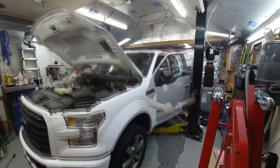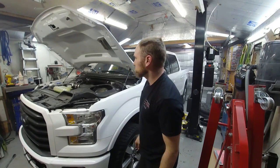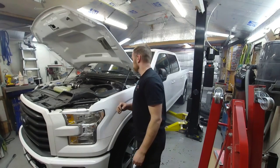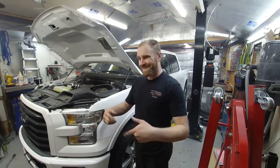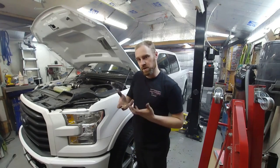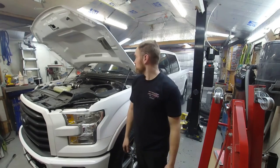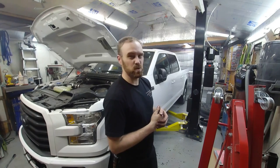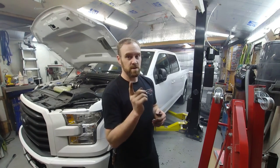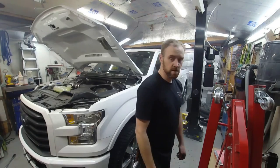That's much better — it runs! I'm calling it quick for the day. A little smoky but not bad — just a small amount of haze, less than I expected. I didn't really do anything in the combustion chambers to cause oil in there, but I did have it upside down for a while and I did pull the pistons up to line them with the crankshaft, so I thought I might have pulled some oil past the rings. Apparently it wasn't too bad — just a little smoke, not horrible. Like, share, subscribe, and as always I hope to see you in the next video. If you stayed with me this long, awesome — thanks for watching, and I'm going in for the night.